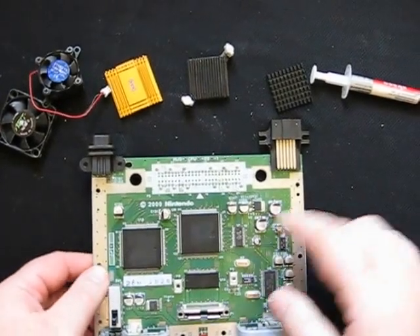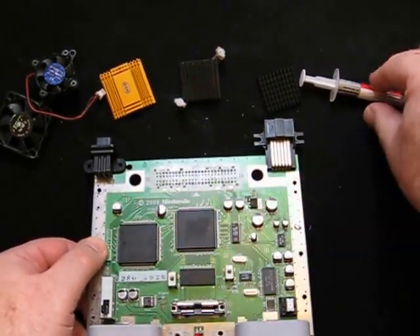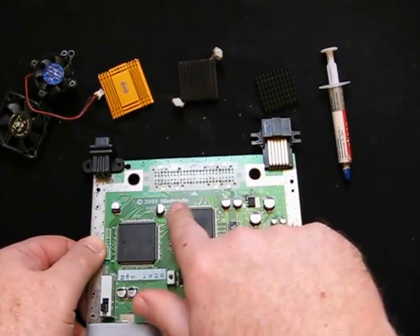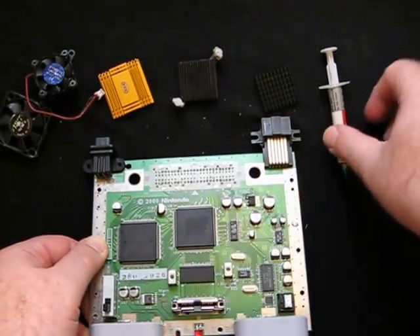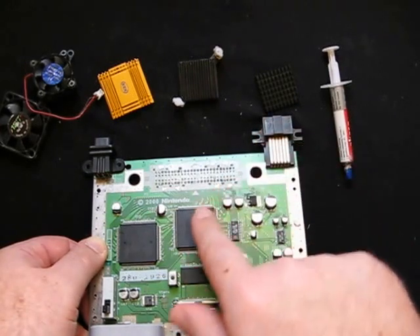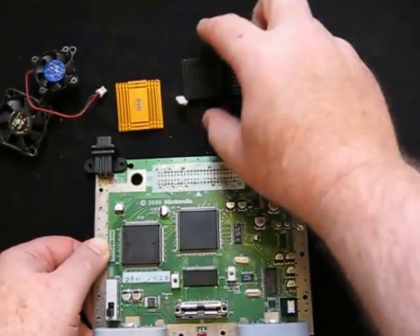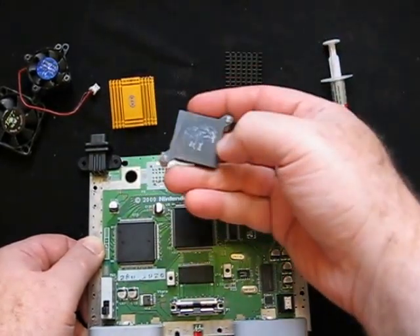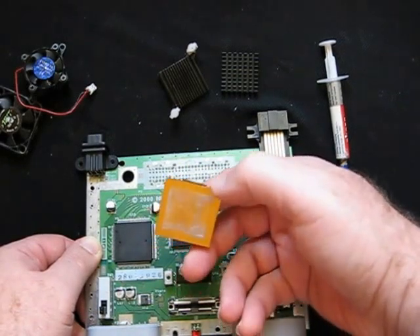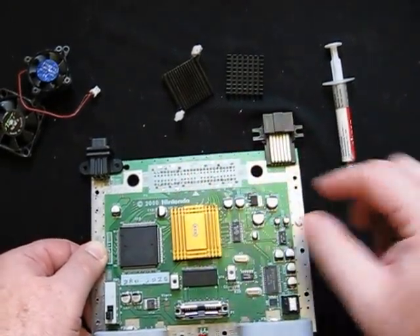For heat sinking and cooling: the processors on many of these old systems can get quite hot. The common process is to put a tiny, tiny blob of thermal adhesive paste and wipe it along with an old credit card or piece of cardboard so the entire surface is covered. The idea of the thermal paste is to get inside any tiny grooves and crevices so heat dissipates evenly — you don't want a thick layer; as thin as you can get away with. Then apply a heat sink — you can get them in quite a variety, even from old computers and boards. Apply a tiny blob of super glue onto the corner, not onto the pins, and when attached, it stays permanently. That's all that's required for heat sinking.